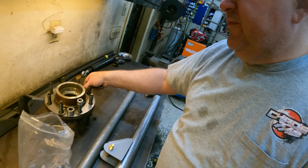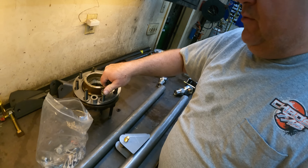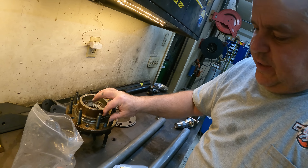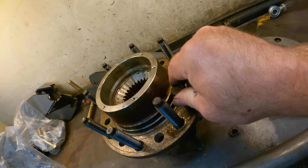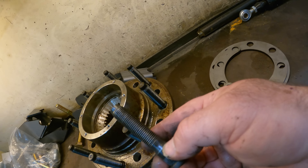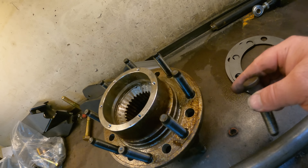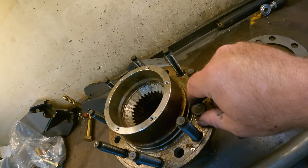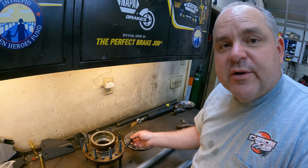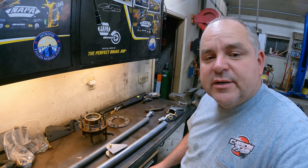To get these to fit, they're just a little on the small side. If you pull all the lug nuts off, you can see this shoulder is still about 10 thousandths bigger than the hole. So I've got a tapered reamer and I'm just going to open these up just a little bit so it's not quite such a press fit. It would go in fine, but it'd be pretty tough to change one on the trail. For now I'm going to start welding these all together and get that thing ready to go underneath the truck.